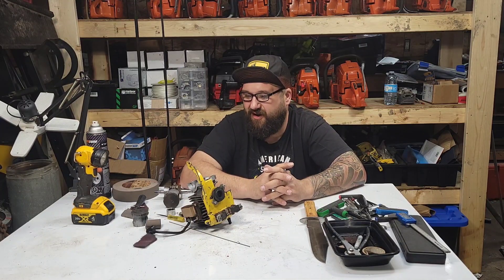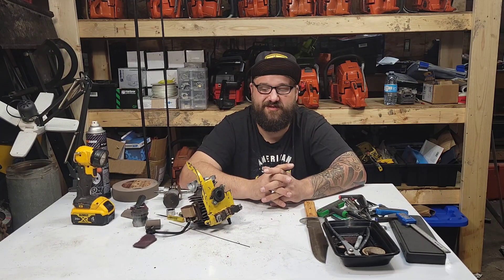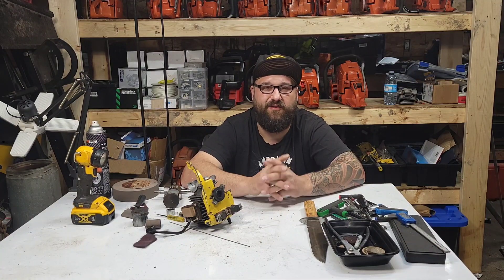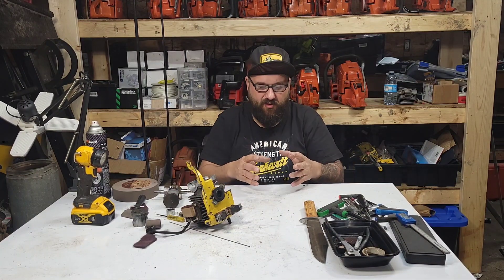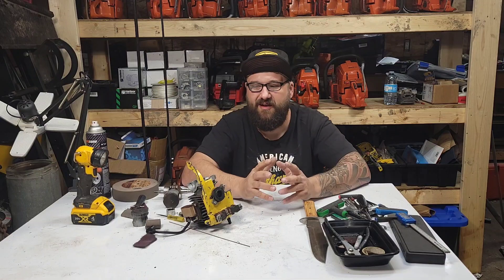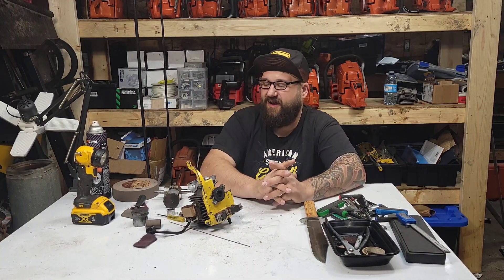I thought, well, we're gonna give this away and send it right back to him. I couldn't test that saw all winter because of the amount of snow — I couldn't get to any wood, it was too cold and too windy all winter. That saw sat on the shelf until I could properly test it. I won't mail a saw away until I've done work with it. We also used that tight nickel cylinder — different plating on that, they don't have a huge crosshatch. I wanted to see how it was going to break in. Those cylinders take a little longer to break in; the plating's really hard. If you buy one, run it pretty fat for many tanks before you start turning it up.